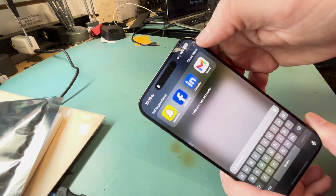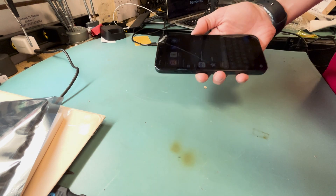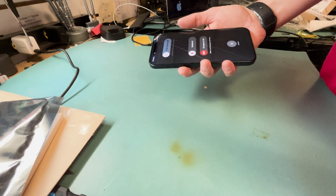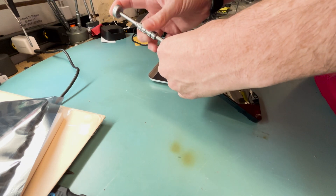Let's fix this iPhone 15 Pro Max with a cracked screen! We gotta get it heated up first, but to do that we're gonna power it down, and then we are gonna grab out our P2 or star bit screwdriver and unscrew the two screws from the bottom.